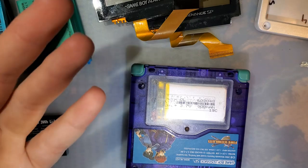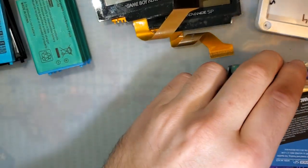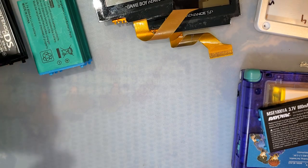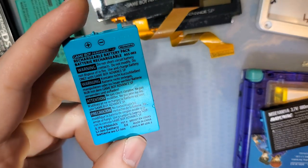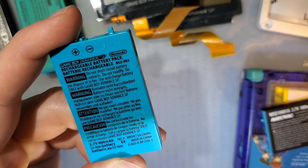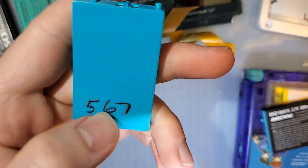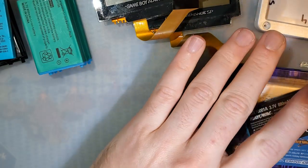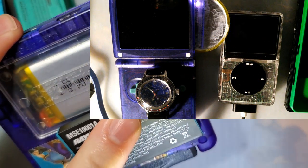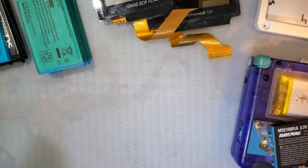While I had the tripod out running tests on these two batteries, I figured let's get some numbers for some other consoles for context. I also ran an OEM battery — this came with a GameBoy Advance SP. Of all the batteries I have, this one tested the best. It's an original 600 milliamp hour battery; I tested it at 567 milliamp hours. In the same GameBoy running the exact same loop at the same brightness, I got about six hours and 48 minutes.